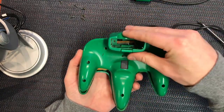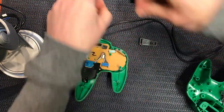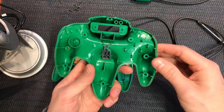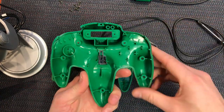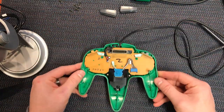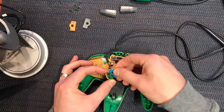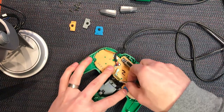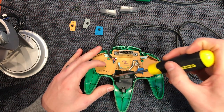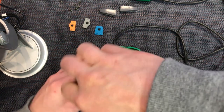The underside is the part that lifts off and we leave the front intact. Those two little ones just fell out onto my bench — put those aside because they are actually smaller screws, but all the others are all the same size. We're gonna give this a wash. The Z button can stay in place, and you'll notice the left and right triggers fall straight out — that's fine. Lift your cable out of the strain relief, lift up the little conductive pads on the sides, and unplug the joystick off the back. There are three more screws around the joystick.